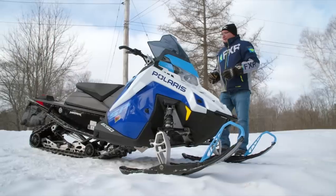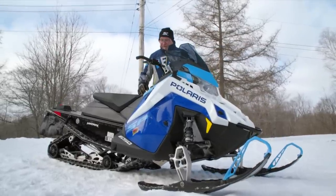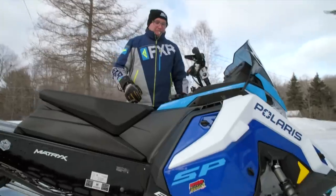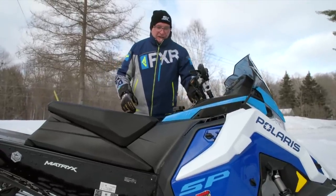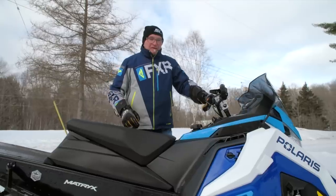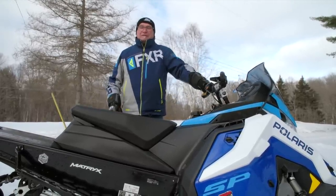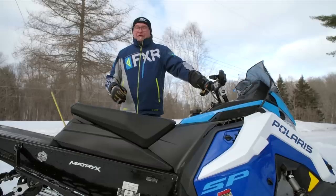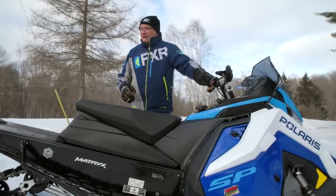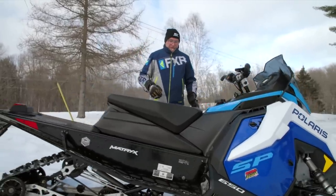Sitting on the gas tank — there's no hiding it — this does not have a pyramidal frame. Polaris never got caught in that problem. This has a high-arching handlebar pole mount. There's a lot of aluminum in this sled. Dry weight, estimated by Polaris, is 509 pounds, which is pretty impressive — it's a pretty light snowmobile for a 650. All the way around the sled, the details we've covered.